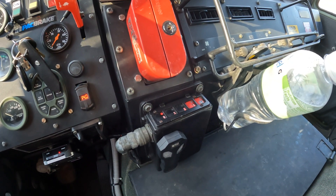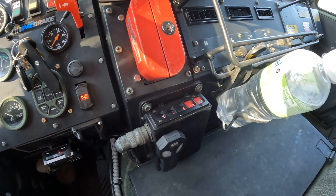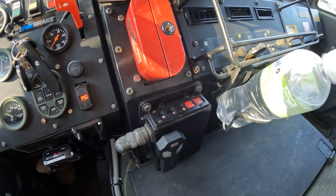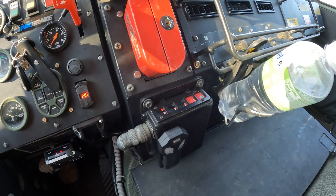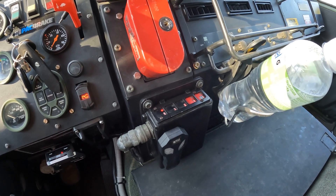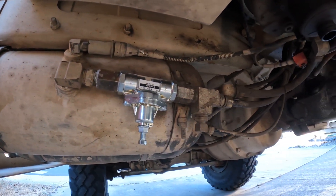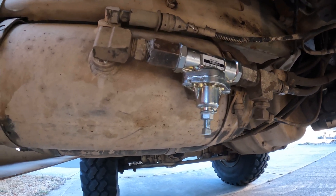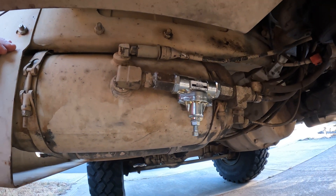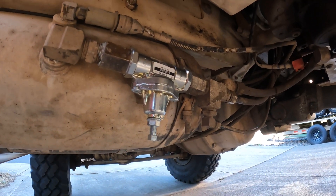So it's checking the tire pressure, filling the tires that might be low, and then we should get a confirmation that the tires are at the correct pressure. And there we go — looks like it works the way it's supposed to. The tank's aired up, I don't see or hear any leaks, so that's good. Hopefully this new valve will cure the malfunctioning old valve — once in a great while I'd have to get out and tap on it because it wouldn't let air through. There's a diaphragm in there that goes bad after a while and it stops working as well as it should.